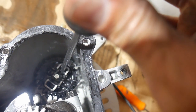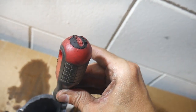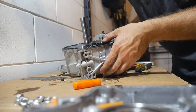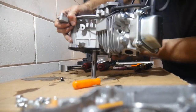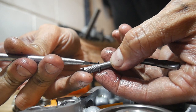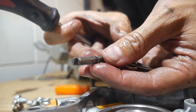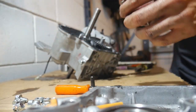What I do is go to the corner where the clip is open and then hammer the screwdriver down back into the engine. Once it gets deformed enough, we should be able to just wrench it out of here entirely. You put the screwdriver right on the broken end and you whack it — it pulls the clip out and will deform it. Then you should just be able to pry it out or dump it and the clip will come loose.